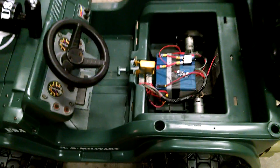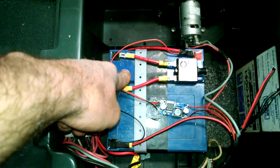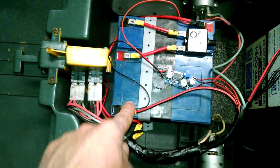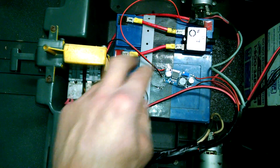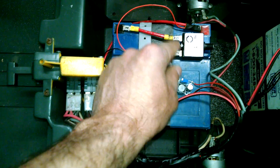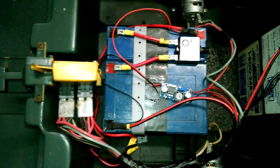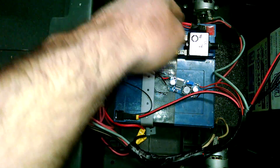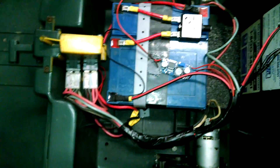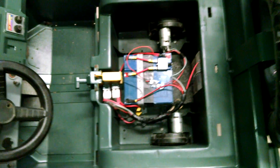What we've got under the seat is a 12-volt Gruber battery and a 6-volt Gruber battery wired in series, so we've got negative-positive-negative-positive — basically daisy chained. We've got a resettable breaker, 40-amp (you can use 30-amp), going into the negative. Then out of the negative into the positive, so that's giving you 18 volts. That's pretty much how we do that.